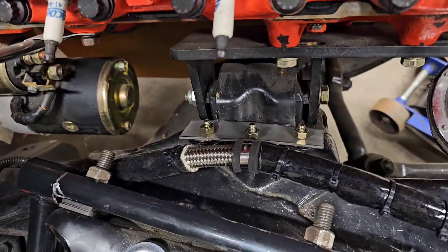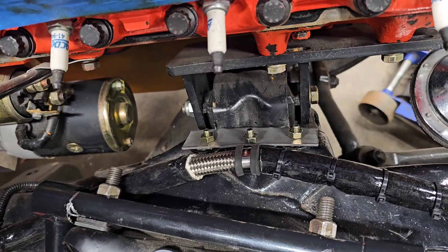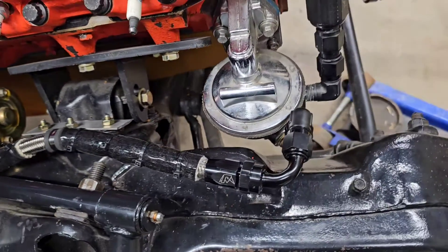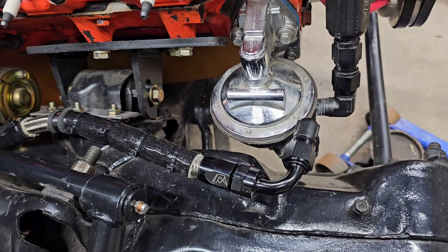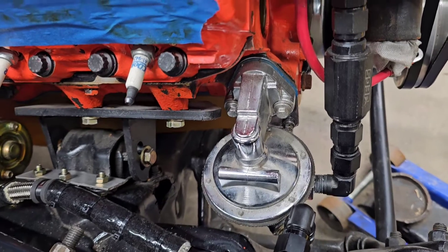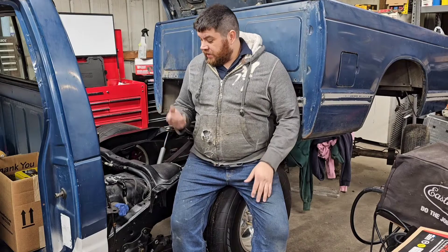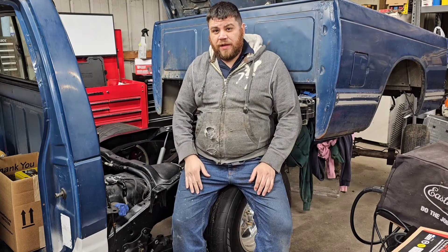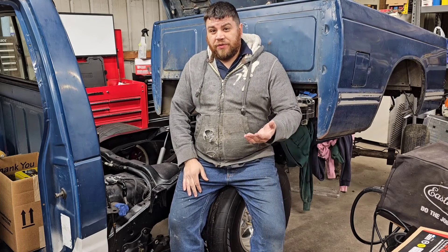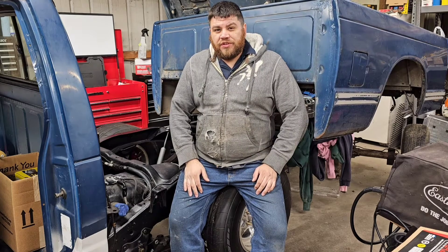From there I made this little plate out of a scrap piece of metal, using the bolt holes in the motor mount to make a clamp mount for the fire sleeve. From the fire sleeve we go to the 90-degree swivel 8AN hose fitting that goes into an 8AN to NPT fitting, also swivel, to our mechanical fuel pump. That's how I did my fuel line from the tank to the mechanical fuel pump up front. Hopefully this video helped anyone who may be watching - if you have any questions, let me know in the comments as always. That's going to conclude the video for today - please like and subscribe if you haven't already, and I appreciate everyone's continued support.